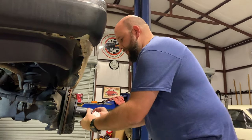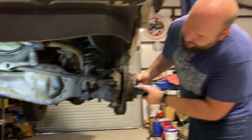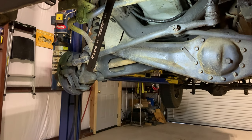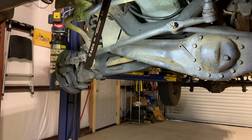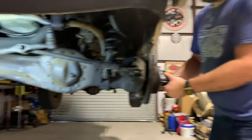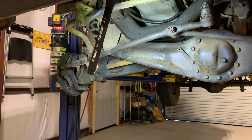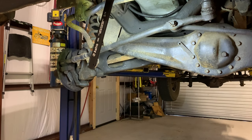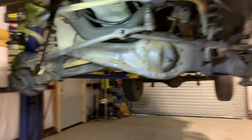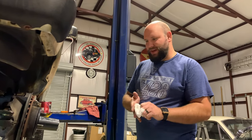Right now it's in free mode. I'm going to turn it to lock. Now if I turn it — the axle over there is turning. See that? Yeah, it's working. So now if I go back to free mode and I keep turning the same way, it stays locked. But as soon as I go back — listen to this. Clunk. And now it's unlocked — it's free. So these hubs are going to work great. We did it right. Now we're just going to get the other side done and throw this wheel on.